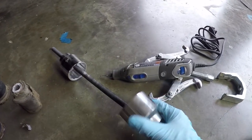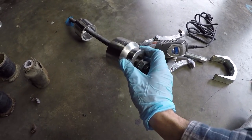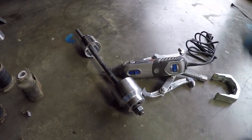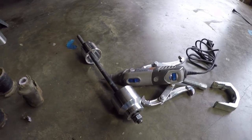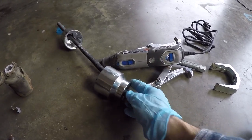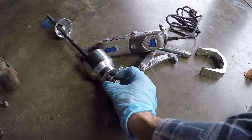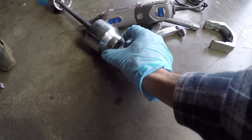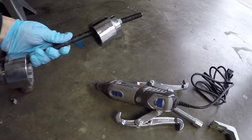And then from the bottom side, I used a, let's see what size. This is a 50 millimeter socket on the bottom to push the bushing up into the subframe. Now I did coat the bushings with some silicone spray just to kind of ease it into place. Silicone spray evaporates, so it poses no issue further on down the line. And then on either end of these sockets are large 14 millimeter nuts and 14 millimeter washers that kind of allow this to ride up the shaft, and the washer keeps the nut from binding with the socket. So anyway, that's the installation hardware.